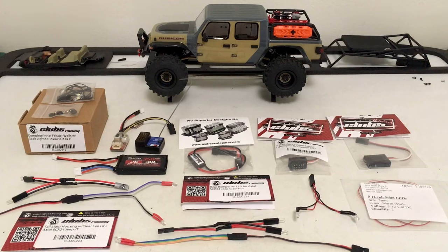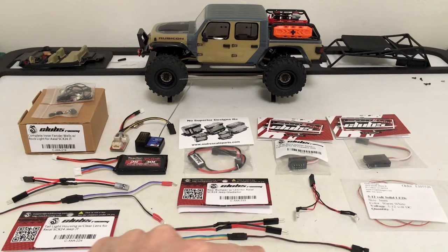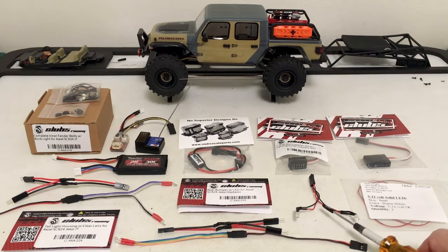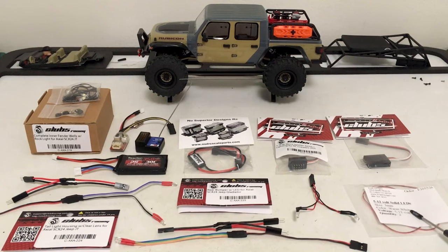And then what's laid out on the table for LEDs, we've got from Club 5, the taillight housing and the bumper kit. They both came with the same setup, a splitter and the lights. So you can see how bulky their Y splitter is. So we're not gonna use either of those. So that'll save some weight and some space. Then we've got the rock lights for the inner fenders from Club 5. So showed those briefly in stage one, but we'll go ahead and get those installed now. Those are just one continuous string. So you can see there's quite a bit right there. And then I've got the stock bumper lights pulled out. We're gonna put those into the headlights. And then I've got from Evan Design some warm white 3mm LEDs. So we're gonna make those into our bumper lights.